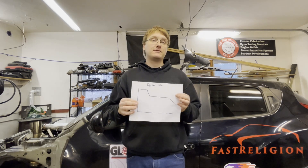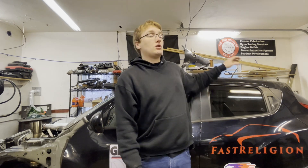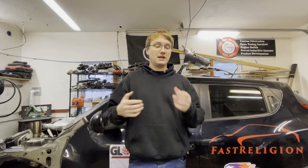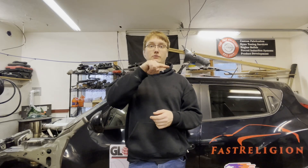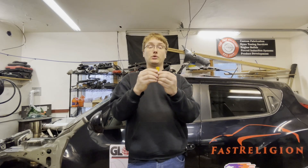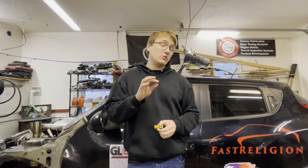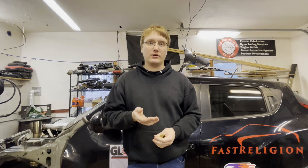So what are the differences in components? On a mechanical clutch slipper, you have a solenoid that bypasses the main clutch line and sends it through the restriction system when you're in first gear or holding a button. When you release the clutch, it slows the clutch fluid by going through a restrictor — I have one right here — just an adjustable knob on top that changes the size of the orifice inside, controlling how much fluid can bypass and how fast. A digital clutch slipper works almost the same way, except it holds the fluid at a certain point, kind of like a line lock for your brakes.